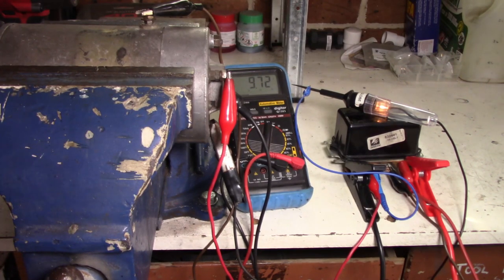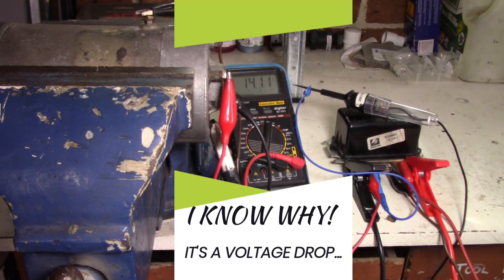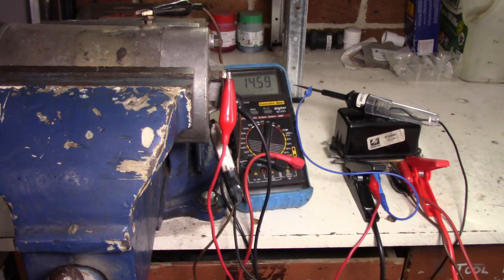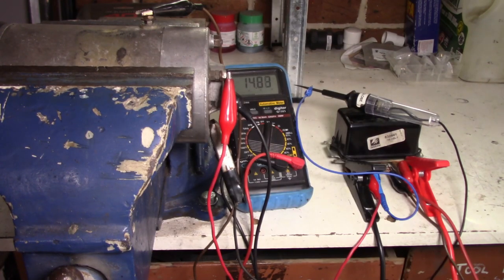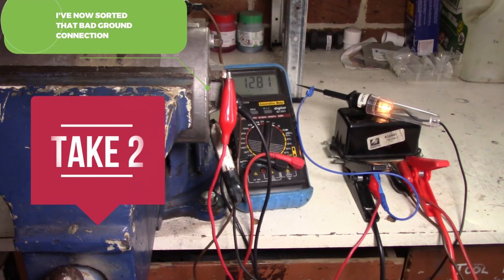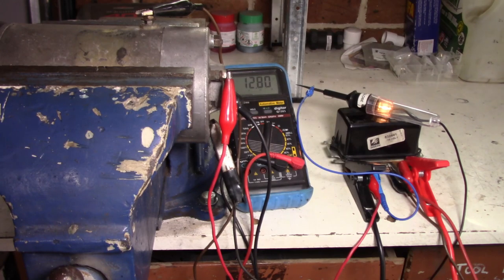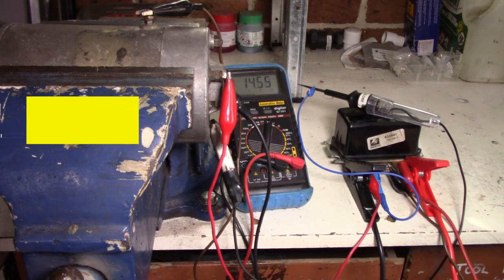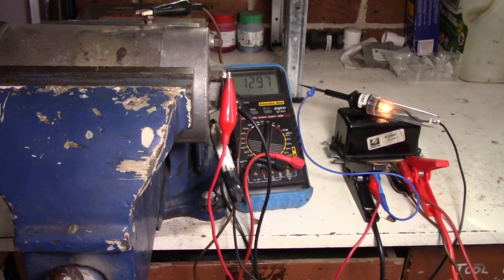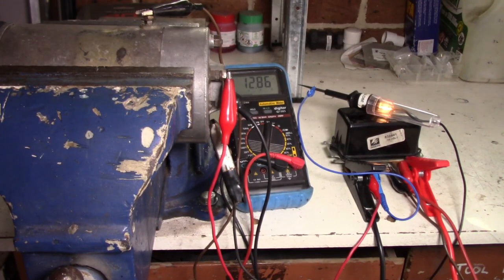Okay, everything's in place. As you can see my light is now on and I have 9 volts down here for some reason. Let's crank that up. The light's gone out and flat chat it's 14.5. The light's gone out, 14.6 — something along those lines. We've got 12.8 volts at our battery at the moment. Let's see if we can get rid of that light and what sort of voltages we're going to get. About 14.7, something along those lines. My generator is putting out enough voltage to be regulated by that regulator and the light goes out. I'm happy with those results.